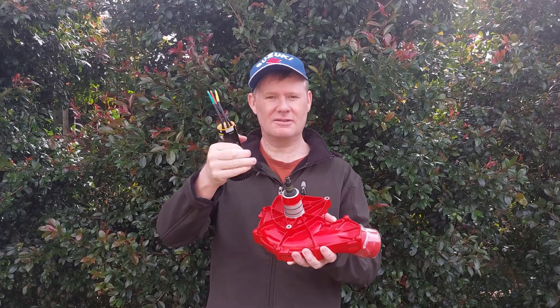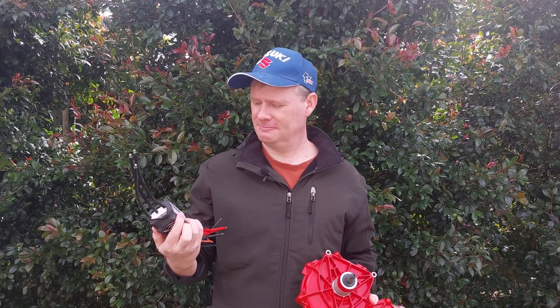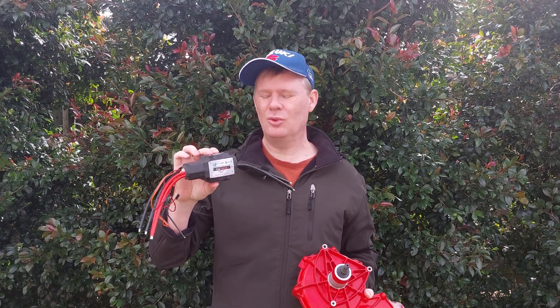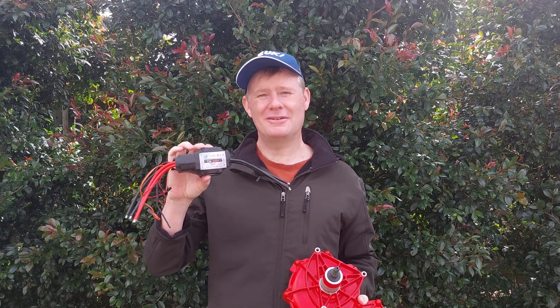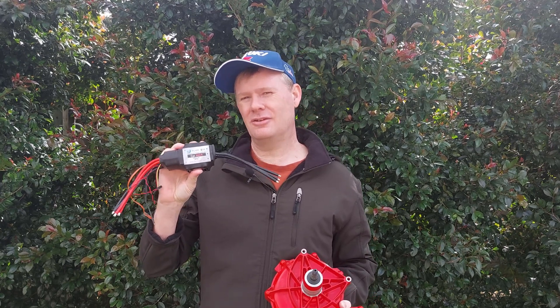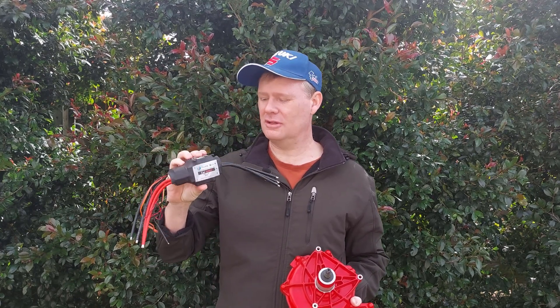With an aluminium plate, we'll sort that all out. To power this we're going to use an ESC — we have a Flyer 400 amp 12S ESC. We'll see how this goes. So far, the people that have electric-turboed their cars using these ESCs have had them explode and catch on fire, so I don't know if I'll actually be brave enough to use this in my car. I'm intending to use a lot less than the 400 amps and wind this up slowly so it might be okay.